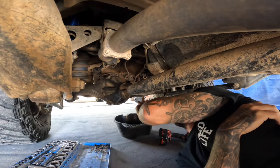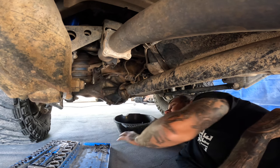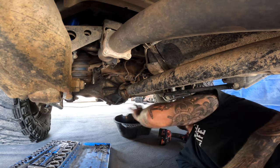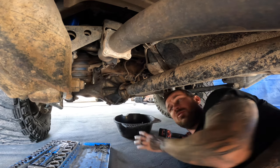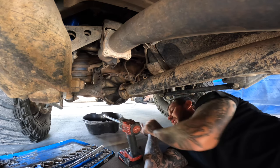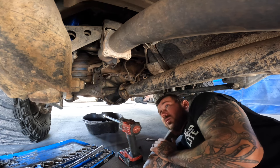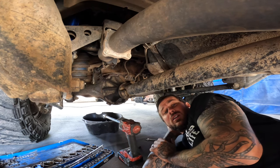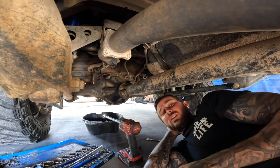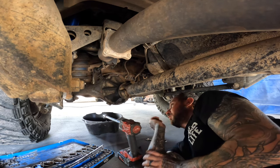We'll get this tail shaft off. There's four bolts around that — I believe they're 14mm. Drop that down, loosen all the center bolts, get my jack under here, and we'll use the jack to help me get it out. I've also got to drain our diff. When you drain it, take your fill plug out first — which is your top one — and then take your drain plug out. It will help gravity feed the oil out, and if you don't, you're going to have trouble getting the fill one out afterwards.